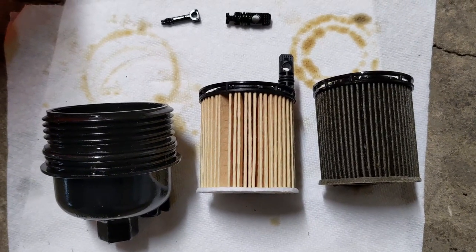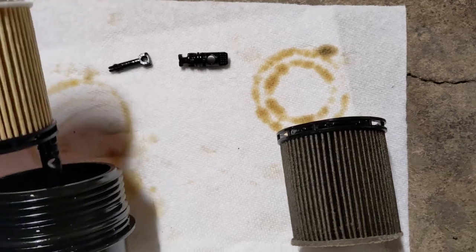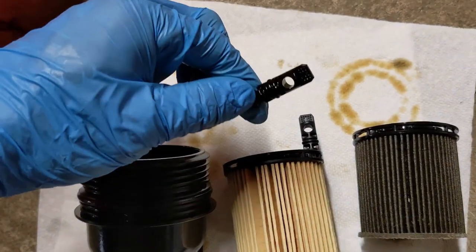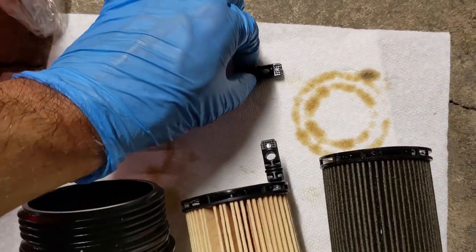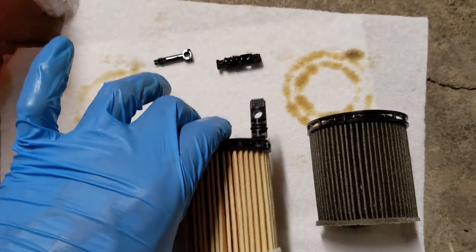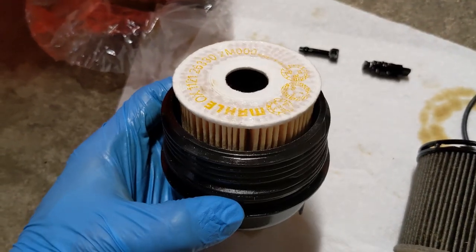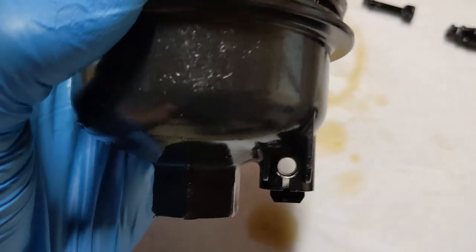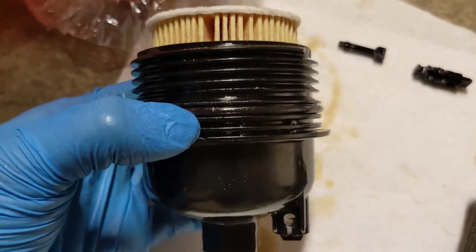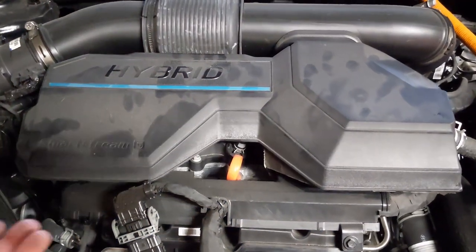Upon taking the new filter out of the box, it actually comes with this little tab — you push that in this way. I didn't know at the time that it was going to be attached to the filter, so when you change your oil you don't need to worry about sourcing that separately. The new filter has one on there, so you'll push it down in there, align that circle, and then push the pin down through. With the new filter pressed down as far as it can go, you can see the plastic tab goes through the little opening — the circle is right where it needs to be, secured with the pin — then it's ready to be tightened back onto the car.